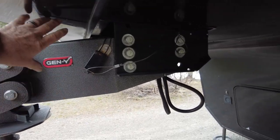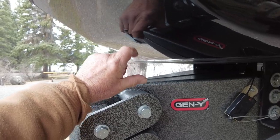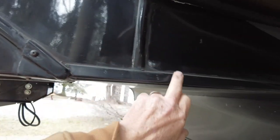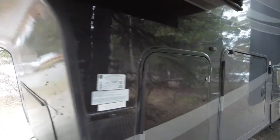The hitch is rotating up when you put it on the truck, or this gap is changing when you're hitting bumps going down the road. The seal is busted — you see excess movement on this expansion joint, or this seal is busted. You can see chafing marks where that sealant has failed. There's movement going on, and for mine all that was happening, and this screw is gone.